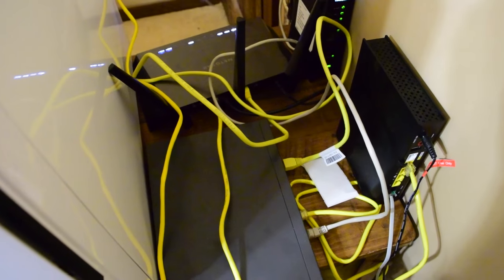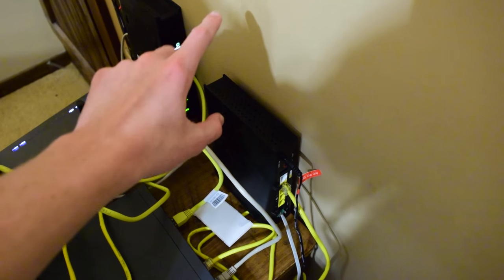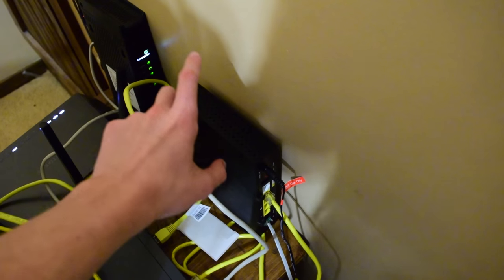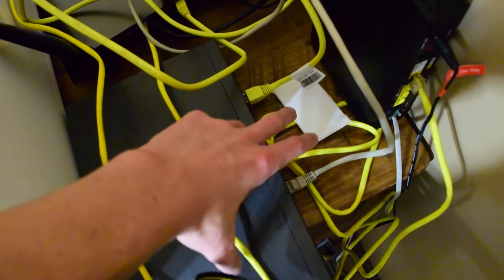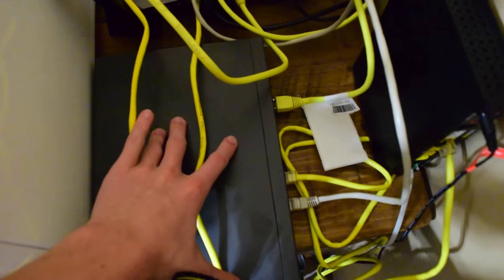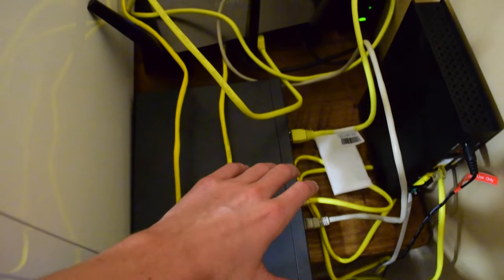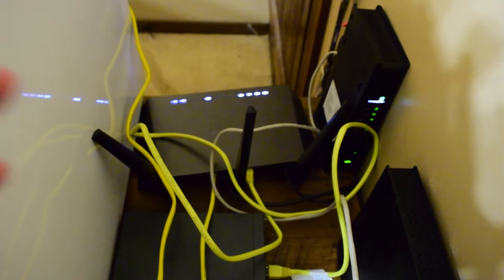Alright, to start off with the routers: there are four — my ISP-provided modem and routers. I will be disabling not only the WiFi but the DHCP servers and the NATs for each of these. This is the TP-Link load balancing router. This one and that one are my two ISP connections being combined. This is being used as an access point and main router, and this is the Nortel switch I showed y'all.